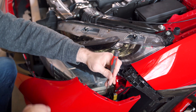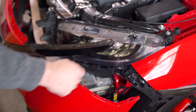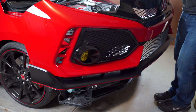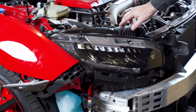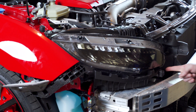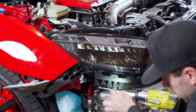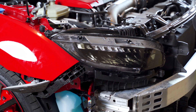There it goes, just fell right off. Before we go any further — one thing I didn't do from underneath was disconnect the fog lights. You can see down in here, they're just little plugs; you just pull those out. When the bumper releases it's just going to fall off, basically just like that. We'll pull it out to the side and set it over here. Now we have four or five 10-millimeter bolts to remove: one here, one here, one right here, and one toward the front going back in there — you'll need an extension to reach it. There's one more right here as well. Now I'll unclip the headlight from the back.